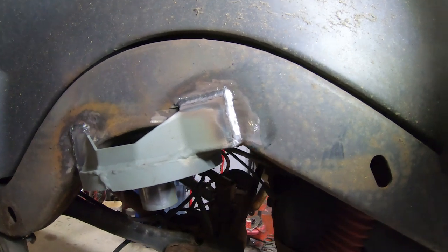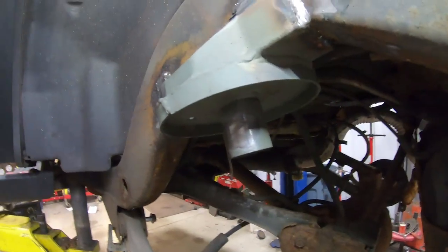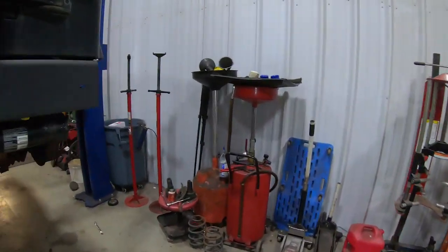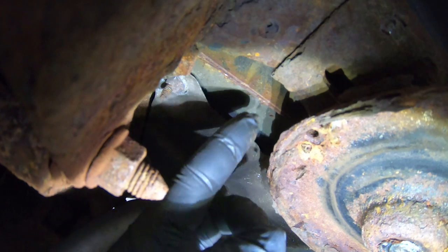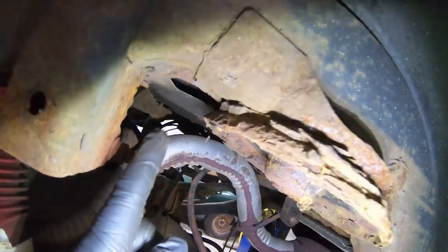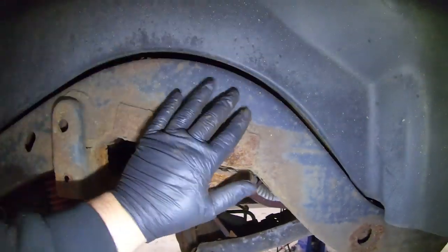We got a little ahead of the game, cleaned everything up, and actually welded in the new spring bucket. One thing I wanted to bring to your attention is that on the back side of the frame you cannot get to the spring bucket. Let me show you on the passenger side - you can see the factory bucket is still here, with these outer mounts that are welded. It welds up on the frame where the body is, and the only way to get to the inside is to actually lift the body off the car. However, I've found over years of doing these that as long as we weld this seam, this seam, this seam, and that seam, and then the spring bucket down here right to the frame, this will never ever move.